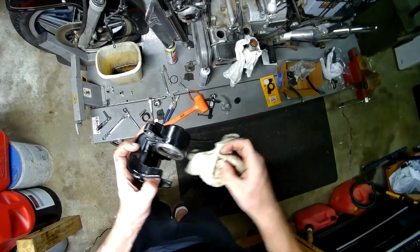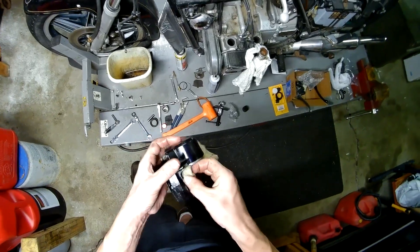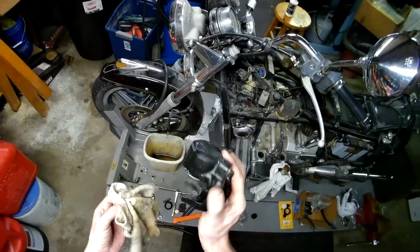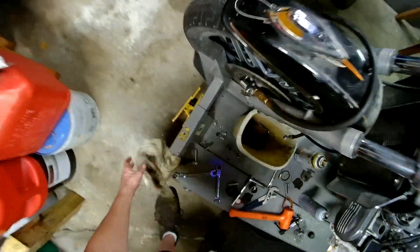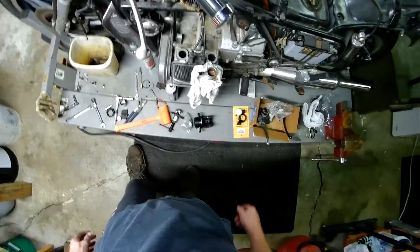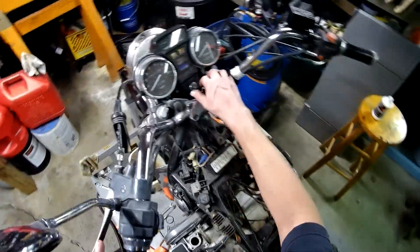Not the worst possible outcome, but I hoped these would be in a little better shape. These need to all be cleaned out - I'll wire brush them, get them cleaned up, get some brake fluid, and put them back together with new pistons. I'll have to take the other one off too, and put it back together first before I pop the other one so I can push the other piston out. Good progress though - we got that one loose and we're making progress. A little concerned it didn't start; the battery's probably just dead and I'll put it on the charger.